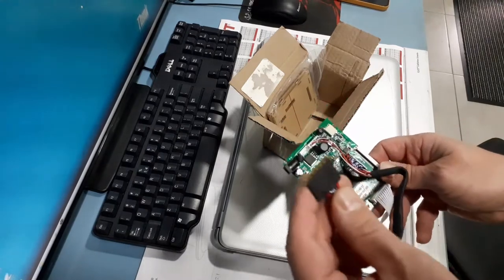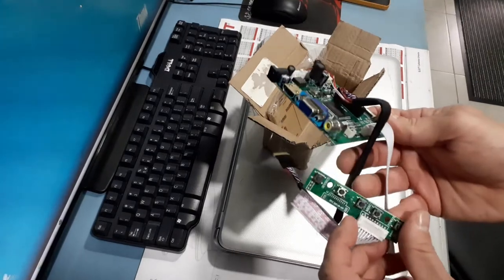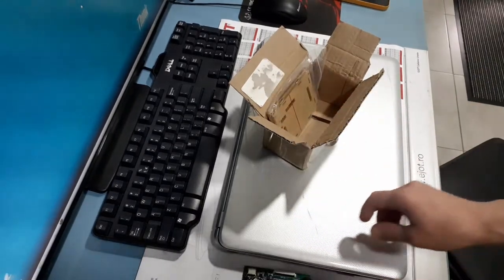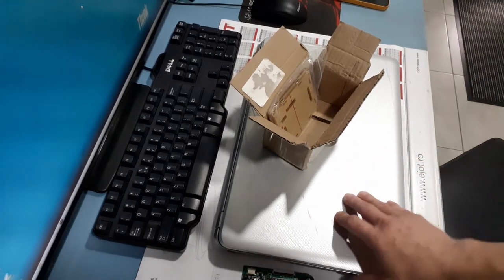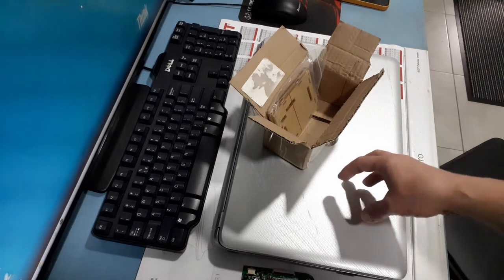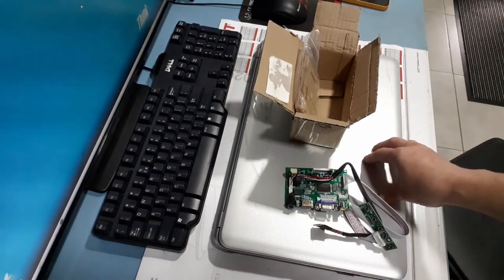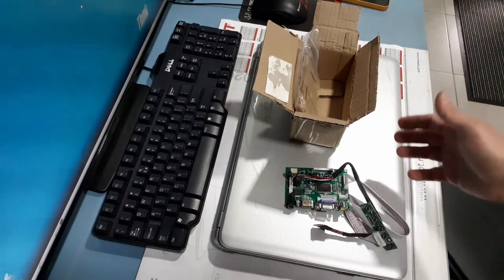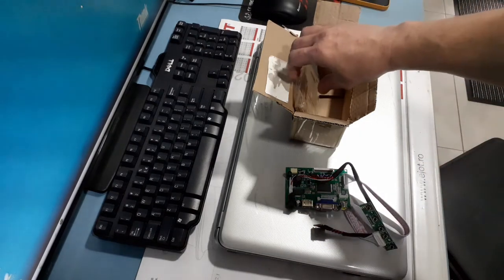This thing goes to the monitor controller, and these are the buttons for brightness adjustment and all sorts of settings, because the laptop monitor doesn't have a proper adapter board which works directly with a computer. You need an adapter like this one. The LCD has only one controller which accepts particular sorts of signals which are not available directly on the graphic boards of the computer.